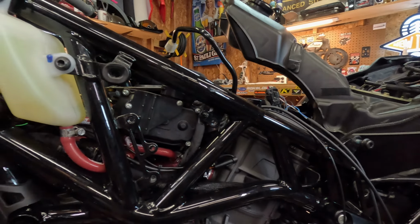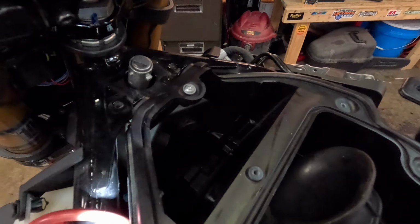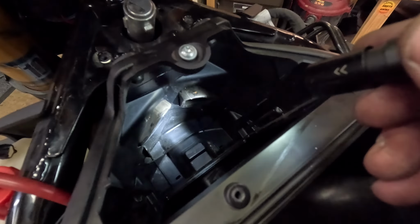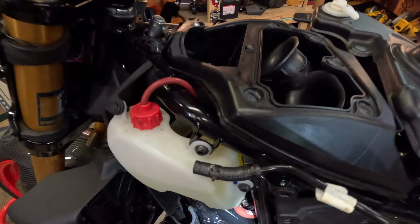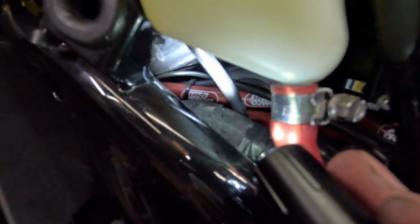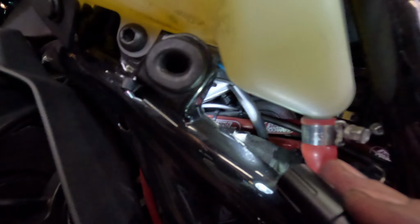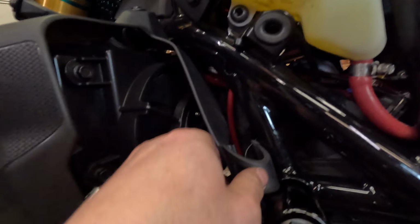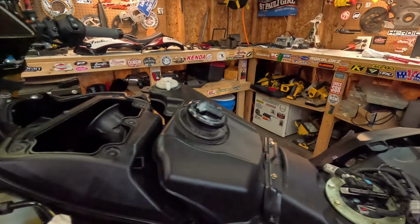And let's put our air box back on. Okay, so with the air box on, basically you get these snorkels in, as you can see there. Your snorkels will be in, and then these two pop in over here. And then I come down here. It's really hard to see, but there isn't much room at all in there. I did wiggle the air box around and make sure there's plenty of room. It wasn't actually binding on anything before I locked her down. Put that back on, put this on.